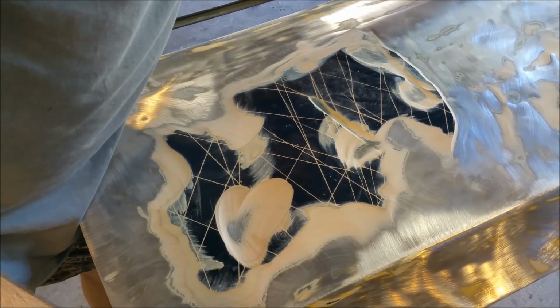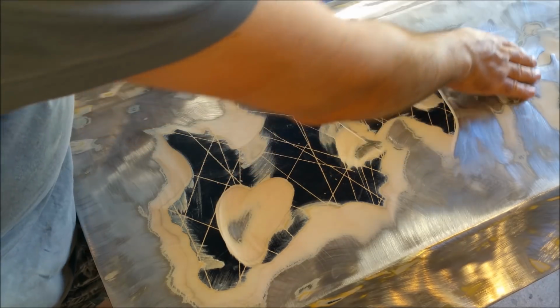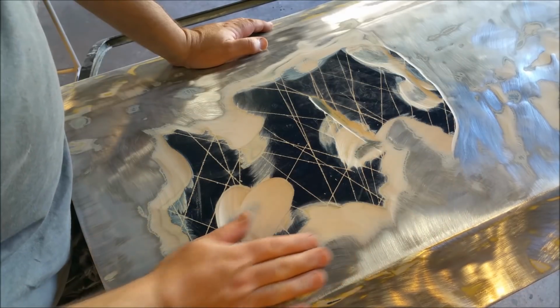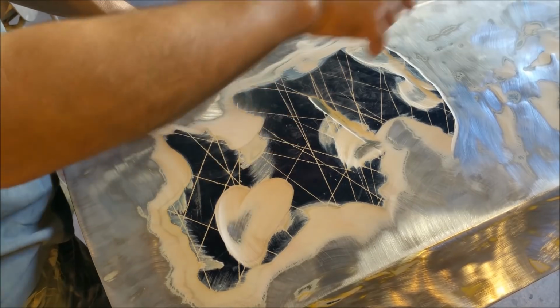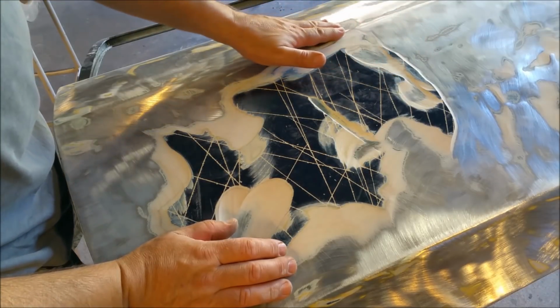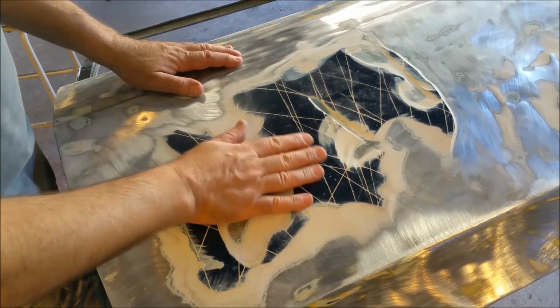A bit of a dimple there, but not too bad. But this centre section here is absolutely knackered. There's huge dents all the way along it. Now, I think what's happened is it's had a big whack and they've just sort of straightened that as best they can. There's a big side intrusion bar on the inside of the door there, so you can't sort of get to it. But they've made the door straight by just recovering the whole thing in filler and redoing it.